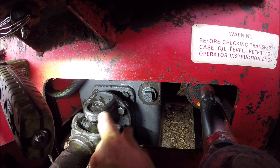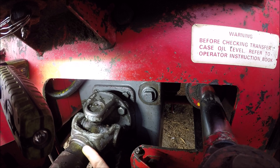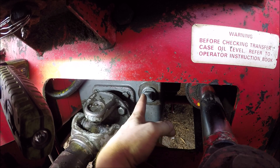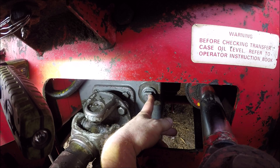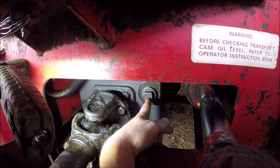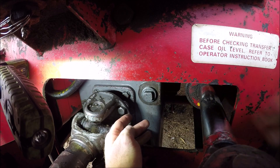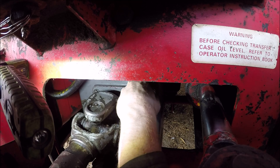We're looking at the back of the transfer box - this is the shaft driving the wheels, and inside is the seal we changed in the previous video. On the 1200 there's no dipstick for measuring the oil in the gearbox. This plug here is both the level and filler. As you can see, it's quite a way in, it's awkward to reach, and you need a funnel with a long spout to get the oil in.